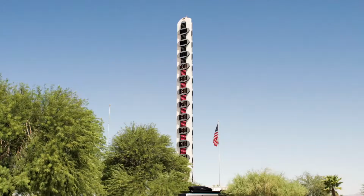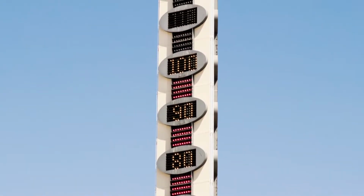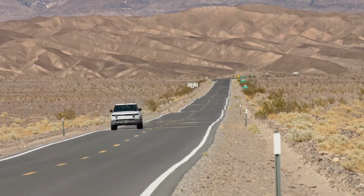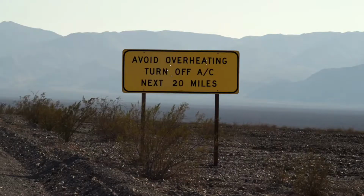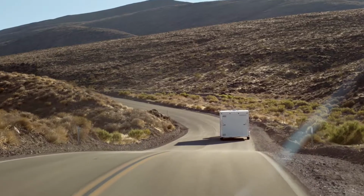What we're gonna do today is go run another step up in severity for our usage cases, like we talked about yesterday on some of the other higher hills, high grades, long duration. Conditions are so severe with the grade, the weight, the temperatures, and the reason we run it is because it's kind of a final check to quantify how good or how robust our cooling systems are.